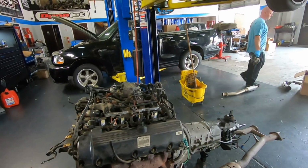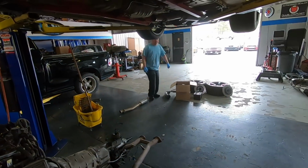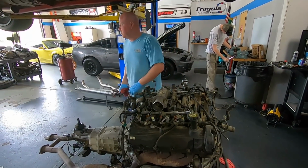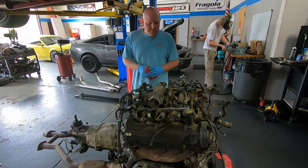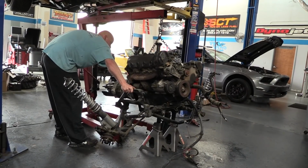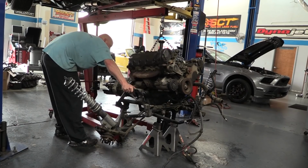Junk. Sorry, ever-growing junk pile. Now Connor pulls the intake manifold to make it easier to lift the engine, unbolts the old 4.6 modular with the transmission still attached from the K-member, and pulls everything out from underneath the car to make it easier to work on.